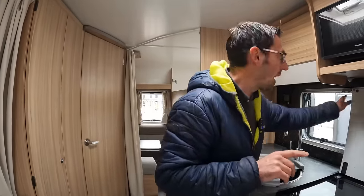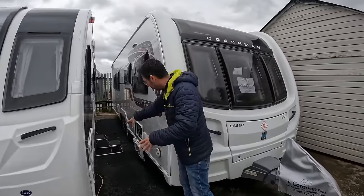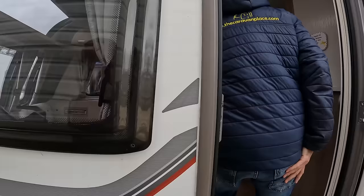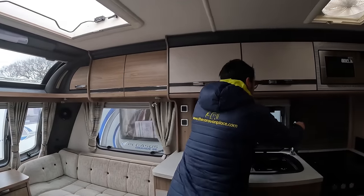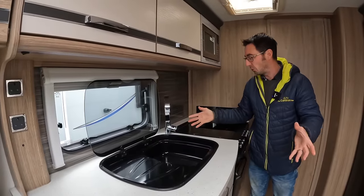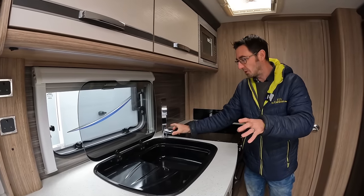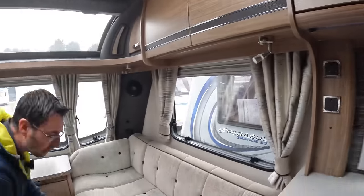On to our water system. We've connected up our aqua roll on the outside, put our water pump in, and inside we've put our water pump to the on position. We can hear the pump pumping but nothing is happening — no water coming through. It will take a little time to get that water through the system. Do your cold first — that should tell you you've got water coming through — then do your hot. If nothing is happening, make sure your drain switch is in the right position.